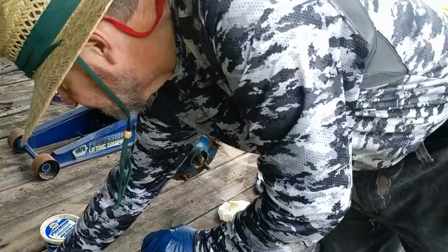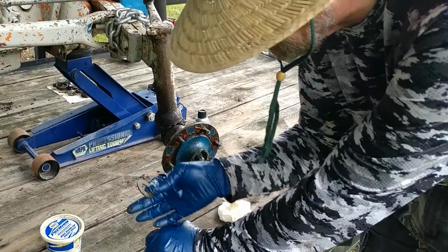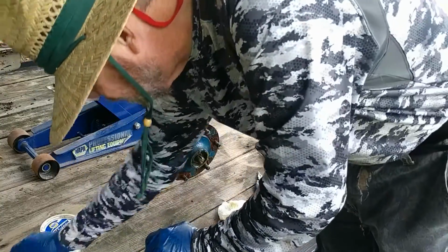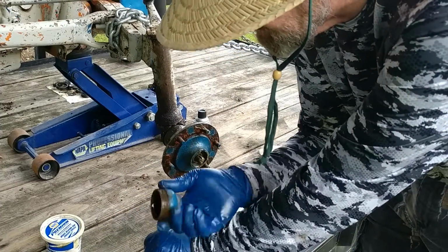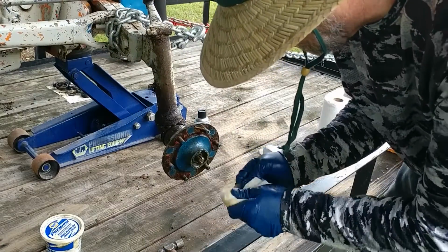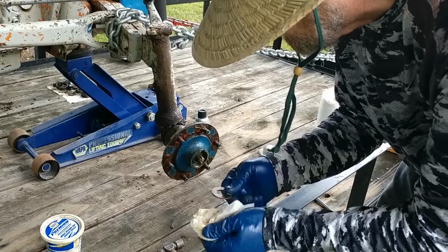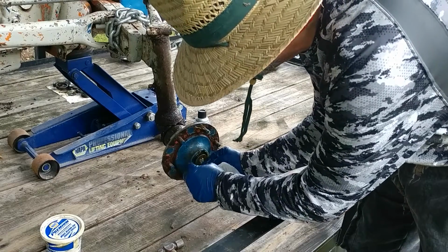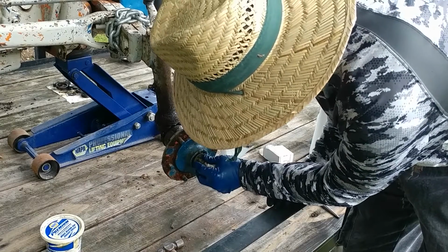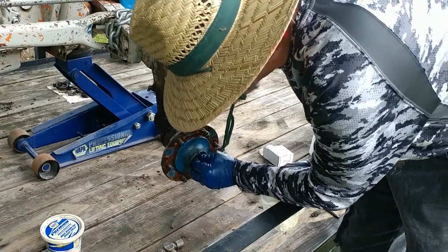Okay, I have some old parts to reuse. This castellated nut, this tabbed washer, cotter pin, which I'm going to get a new one to replace it, and this threaded dust cap. Now then, they go on in the order they came off. So wipe off this tabbed washer, and the tab goes in this slot right here in the top. Come on. There we go. It should slide on very easily.